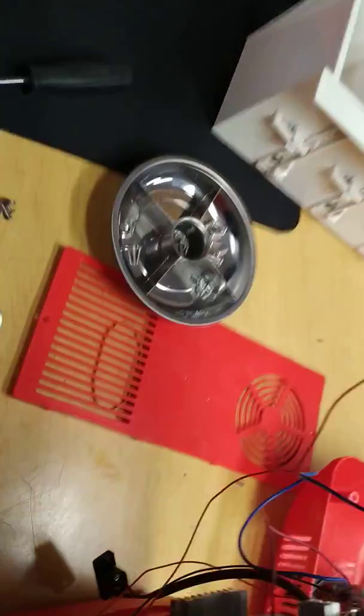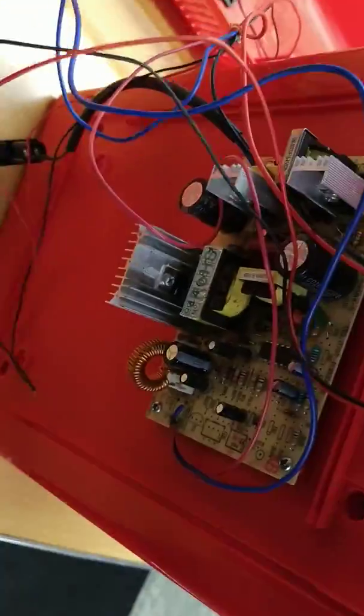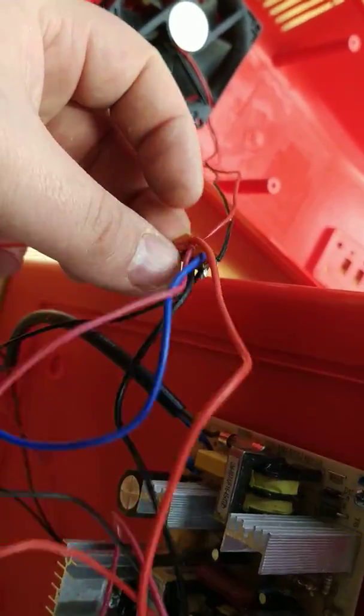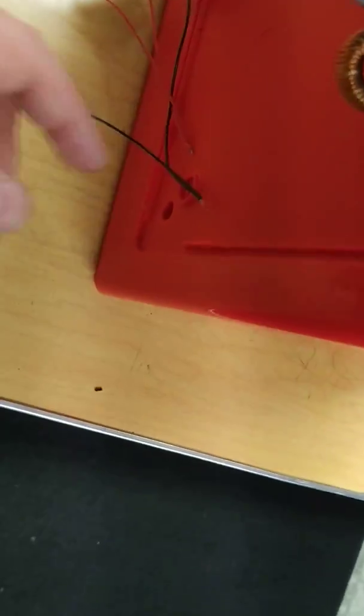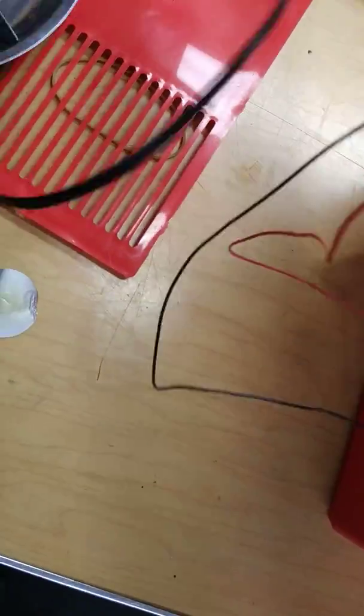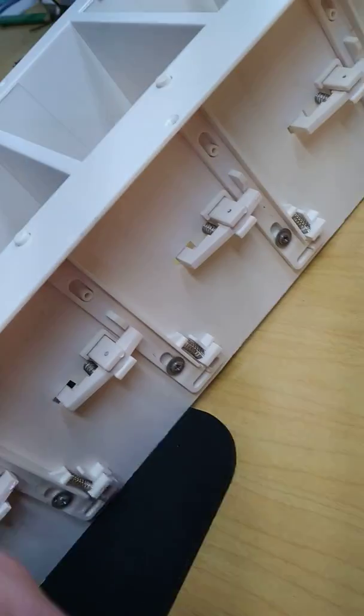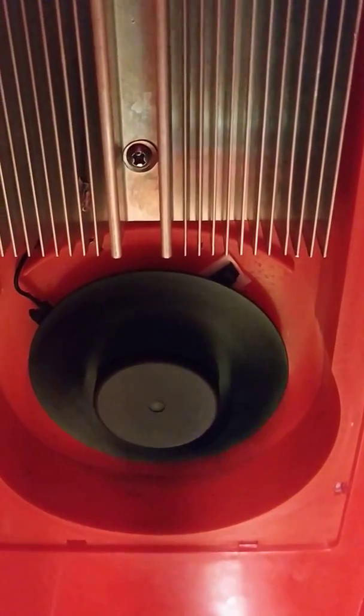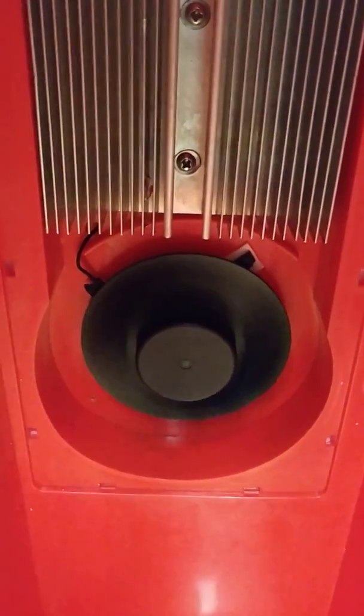Now let's plug it in. I've got my new wires twisted together. I had to replace the complete control board switch with just some Arduino board I had laying around. Positive, negative — those are twisted down there. Make sure my wall adapter is still plugged in. There's the fan that goes in the back that blows onto this heat sink. And that fan took off — it's supposed to sit there. Hey, what do you know, that fan took off too! Because that one is actually double-sided foam taped into place, since you can't get that part anymore. You know, I had to make do with it.